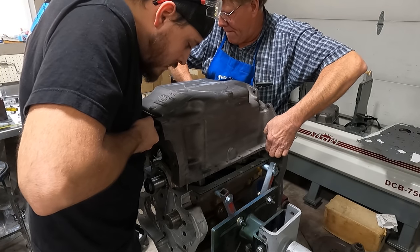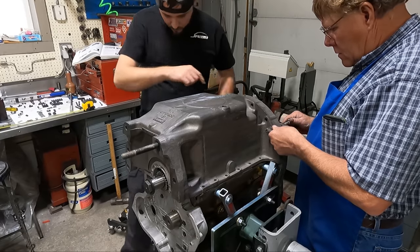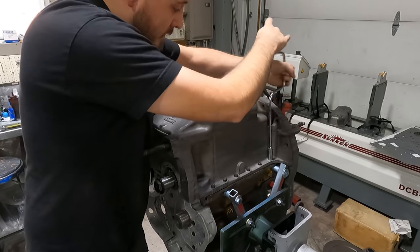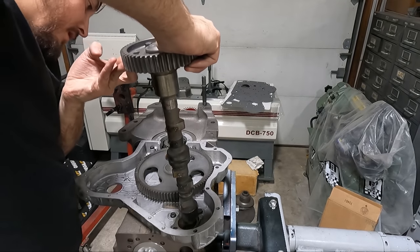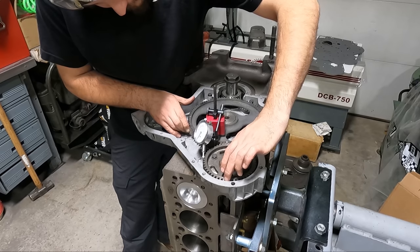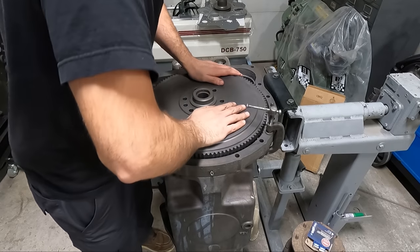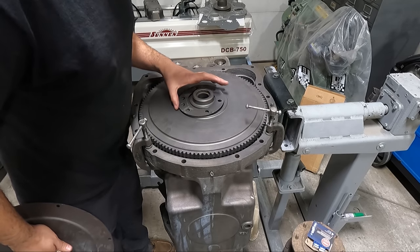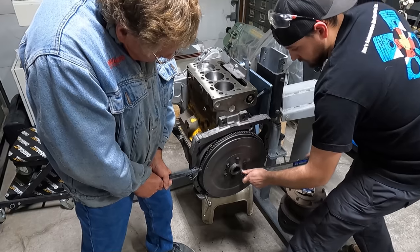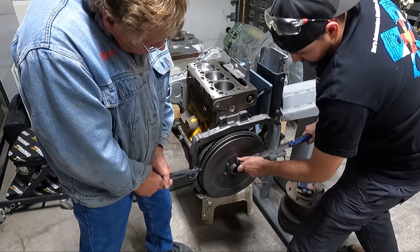I lubed up the gears on the oil pump before covering it up, and I knew there was no way I could handle the massive cast iron oil pan on my own, so I recruited my dad's help. Before tightening all of the bolts down and torquing them we pulled it tight against the trans adapter plate using a couple of clamps. Back to the front side of the engine, we got the camshaft and idler gear installed, being sure to properly line up the timing marks before torquing down the idler gear bolt — and obviously we have a good amount of assembly lube on that camshaft. Moving back to the rear we got the flywheel, shims, and flex plate installed with the bolt pattern aligned correctly, and my dad held the flywheel so I could torque the flywheel bolts to the proper specification.